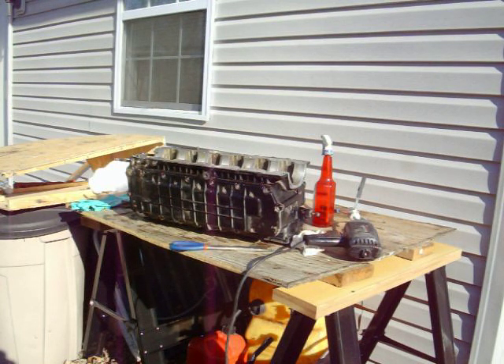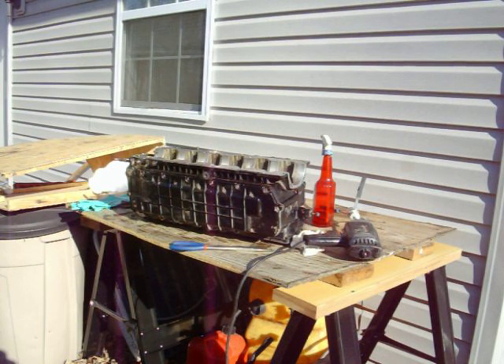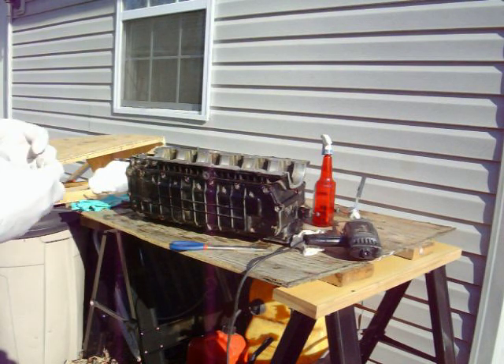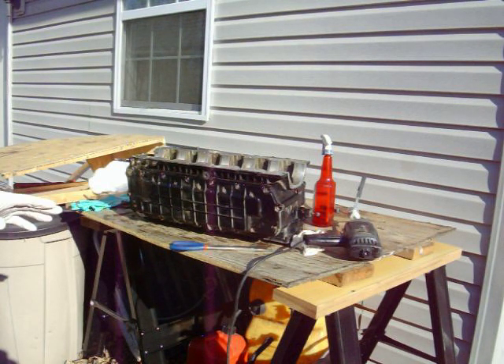Right now my next phase is to go ahead and pull the pistons out, and I'm going to start pulling those apart. I'm going to soak down this cylinder block right now with oil again, put the lid back on it and cover it with a bag just to make sure it's nice and oiled up good while it's waiting. I don't want any more rust or anything. By the way, I cleaned out the cylinders after honing because the honing actually creates dust and particles that can sit in there and cause issues down the road. So after honing, you always want to clean these out.